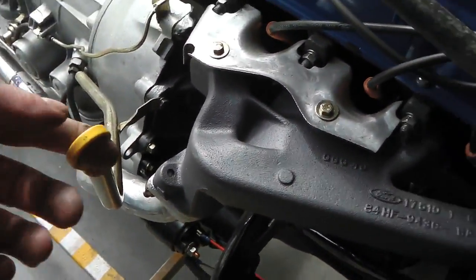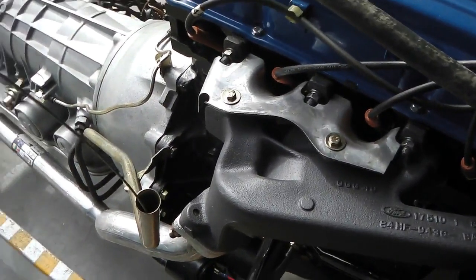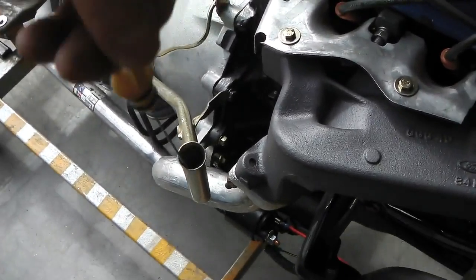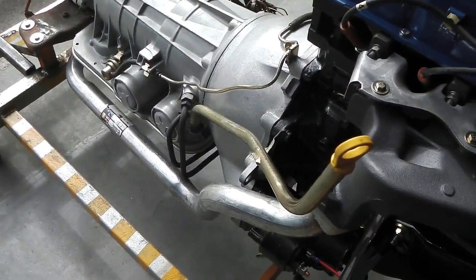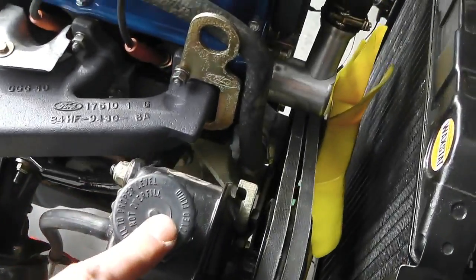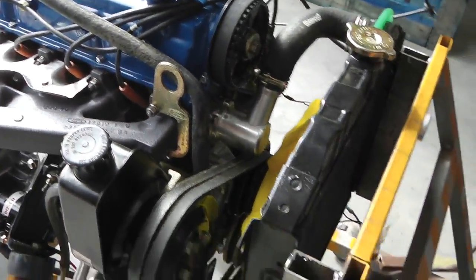I'll just feel better. Our torque converter has taken up the fluid and dropped a good quart into the torque converter itself, dropping the level on the dipstick to half, so we're good there. Don't really know what the gearbox is up to yet. We think it's all spinning up. Power steering pump's dry, so we're going to keep our eyes on that. Other than that, we're ready to do a more sustained test now.